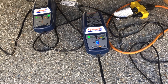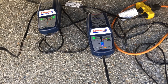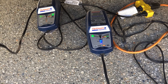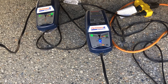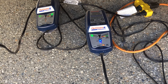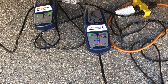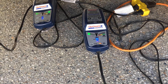I just threw the 12-volt switch to off, which cut the drain, and within a minute or two it did a self-test run and then came back to charge. Notice the red light's off — it's in full charge mode, not pulsing or anything, and it's putting between one and three amps in. So it's not a lot for 240 amp hours; it's only taking a few amps. I'll come back out and see whether this goes green.